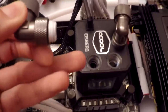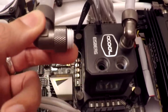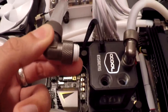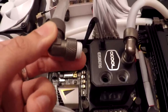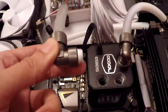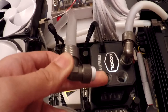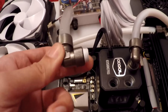I screwed this in quite tightly with about three inches of PTFE tape. I think I'll take this off, apply a fresh piece, put it back in, tighten it up, and start filling up the loop. I need to see if anything falls into the system or into the pump when I take it off, but it seems to have stuck on quite well and hasn't unravelled itself.